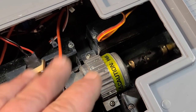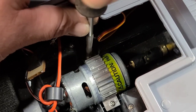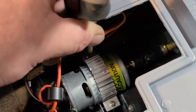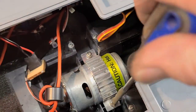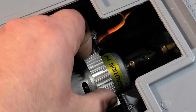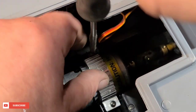I'm going to try to pull the motor. If that universal joint's missing a grub screw, it should just pull right off that shaft. It looks like just these two screws to get the motor out. This motor is actually air-cooled — there are vents in the cabin that allow air in and out of the boat, which is nice.